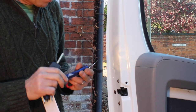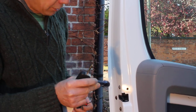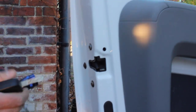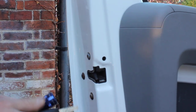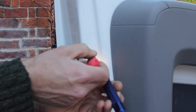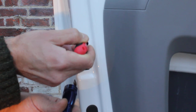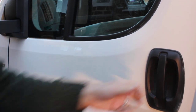What you are looking for is that little hole there just above the door lock. You will find a small screwdriver and a torch very useful. Shine your torch into the little hole, insert your screwdriver into the hole, and in there you will feel there is a little plastic catch. Flip that catch into the up position, just shut the door, and it is now locked. Voila!